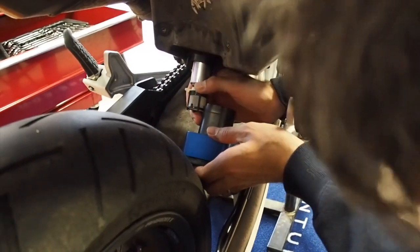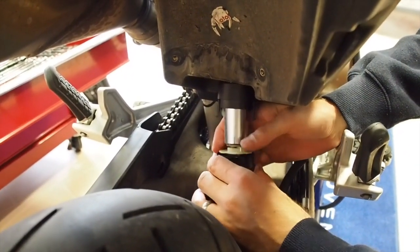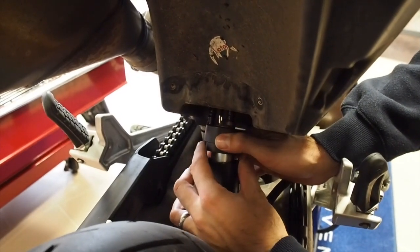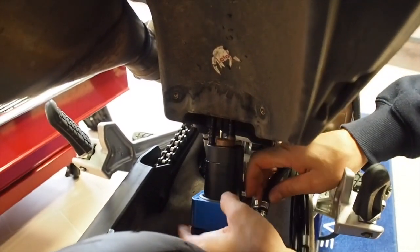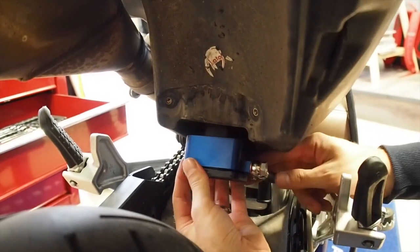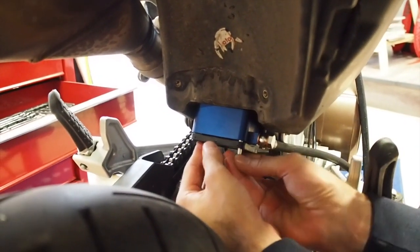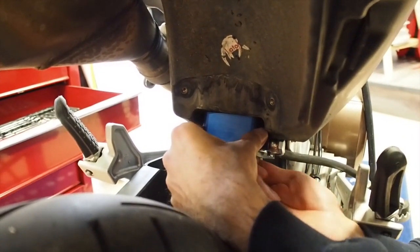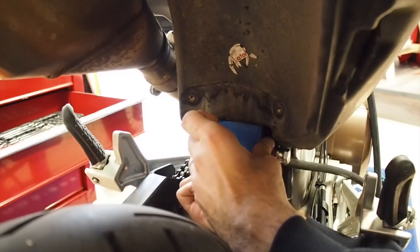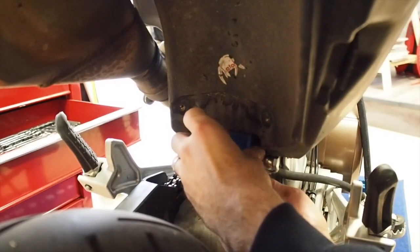Now you'll be always careful with the fuel pump, because there is a lot of wires and electrics. You put it in carefully. Both hooks inside — that click, that's a noise you need to hear. And now again carefully. In the bottom, just make sure it fits well. And you take the bolts — I think it's M5 by 50 or 55. When tightening, you have to be very, very careful — you have to tighten well. If not, there is leaking of gas. If you tighten too much, you destroy the threads.